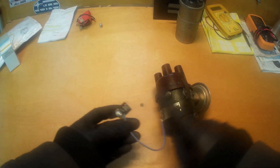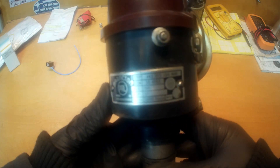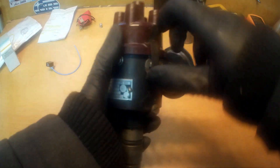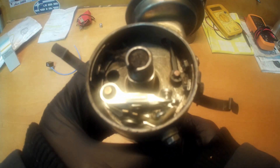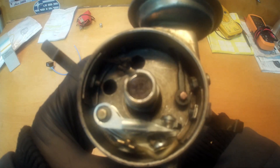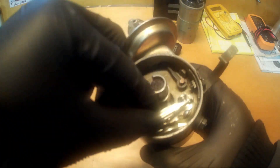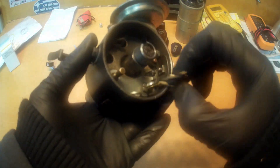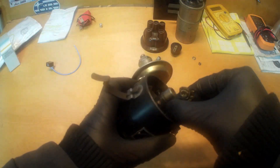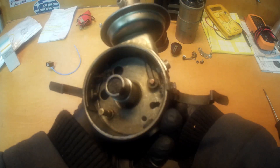Installing the 012CW sensor is extremely simple. Although I am demonstrating this on a Skoda distributor, the installation procedure is identical for other distributor types — the only difference being the sensor type and shape. As a first step, remove the distributor cap and rotor. Then remove the points system from the distributor: first the upper contact plate, followed by the wire leading to the coil, and finally the lower plate, which is held in place by a single screw. This eliminates all mechanical contact with the distributor shaft.